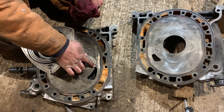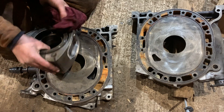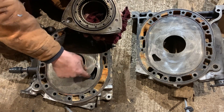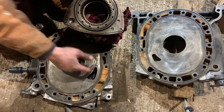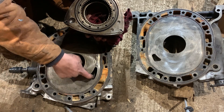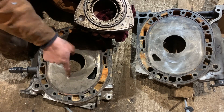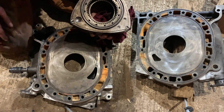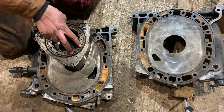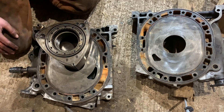The inner bit here where I did very little porting — this is actually the area for the oil control seals where they sweep past. I tidied up a little bit on my actual ported ports because it's a bit tight here, and there's a lip here which is not good for airflow. However, if you port too much and actually port into this section on your oil control rings, you're going to ruin your path and you're going to have a smoky engine because these will no longer be sealing as well, pushing oil out onto your irons.